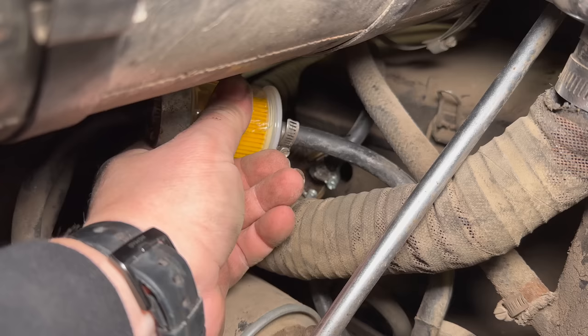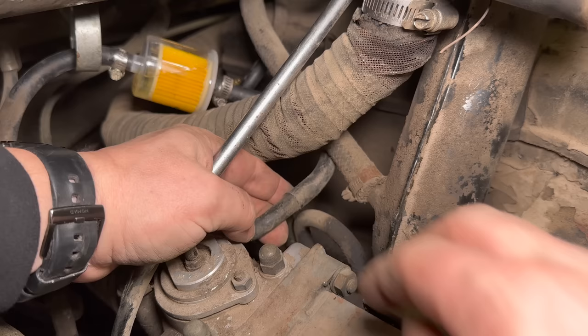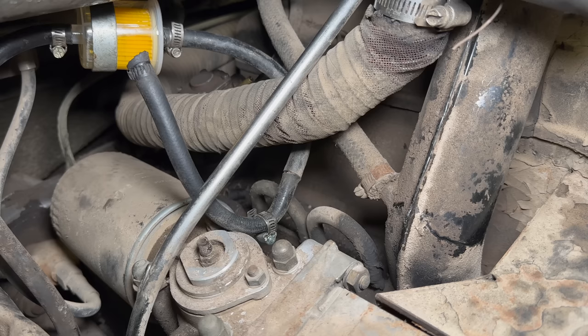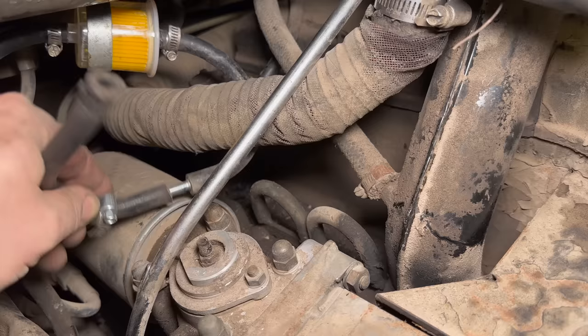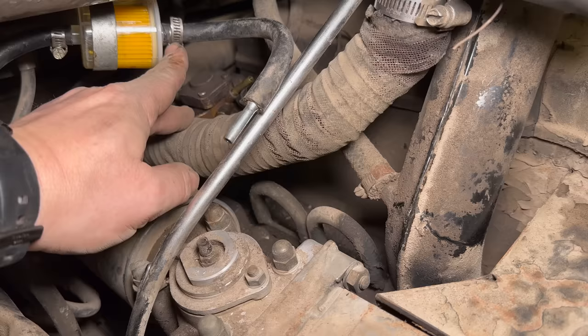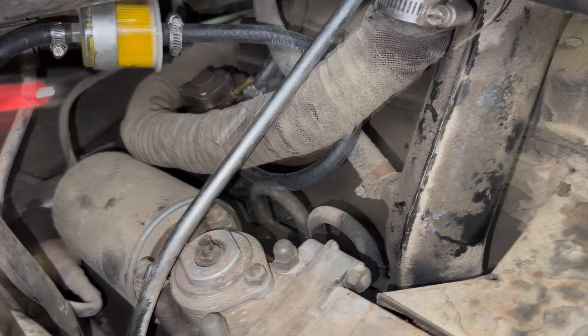Maybe our fuel pump is bad after all. I'm curious about what's going on right here — it kind of looks like the hose is made of two hoses right there. I hope it's not leaking. That bottom hose was really stuck on there; I don't think it's been off in a very long time. Look at that — there's actually a joint here, which was probably a pretty big air leak. I'm not sure why that exists. It looks like it adapts from one size hose to another, but our filter is the correct size. Maybe someone at some point had the incorrect filter size and needed to adapt the hoses, but we don't need that, so let's get this out of here. We now have a single hose with no chance of leaking in the middle of it.